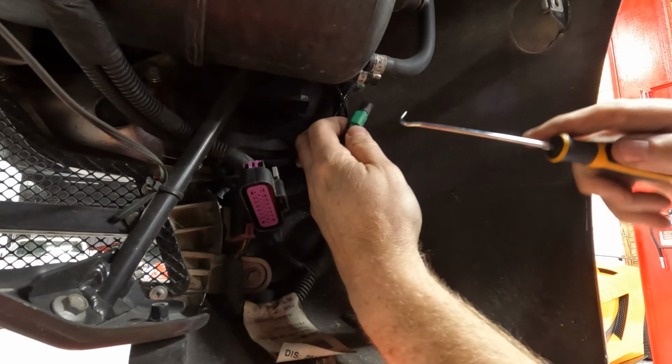On these, there is, what is it? It was a washer on each side of the bracket. So one like here, slide it through. Now I'm not gonna tighten any of these down until I get the rest of the exhaust installed, because lessons learned there. It always needs to be adjusted a bit. I'm just gonna put the bolts in, to prevent it from moving around while we get everything snugged up later.